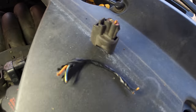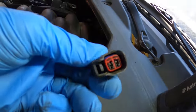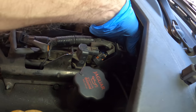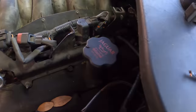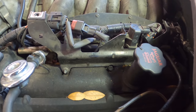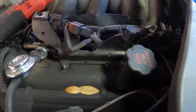I'm going to need to replace that connector and figure out how to splice it into this harness — that's going to be a challenge, there's not much space back here. I went to check if a new connector is available, and surprise surprise, the parts store actually stocks this. I need to strategize how to get in here and gain access to these wires, because those rats — or squirrels, mice, gerbils, raccoons, whoever — chewed that wire off right down to the nub. I think I'll pull this bracket off to give me enough space. I have a plan, but we all know how my plans work out — they end up having me doing things twice or thrice.